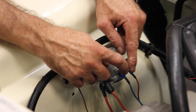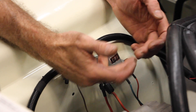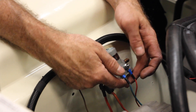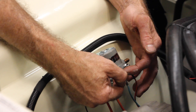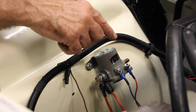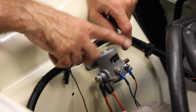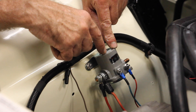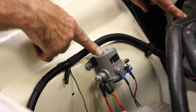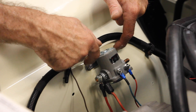The previous owner had taken off the rubber coupling that connects these two — they're not actually physically connected, just a harness that branches between them and plugs onto the two posts. The previous owner had cut them out, so I just put terminals on and screwed them onto the posts. This is a solenoid for a manual transmission. The automatic transmission likely has a third post underneath the solenoid. The other post on the right side goes to the four-gauge wire that runs down to the starter motor.